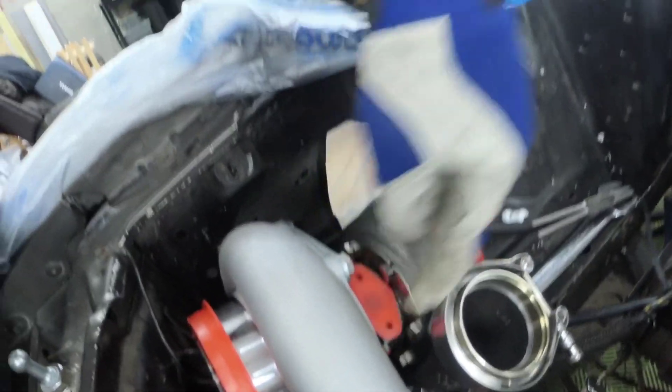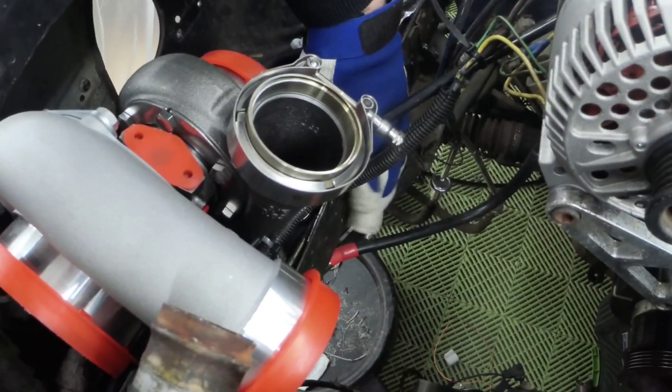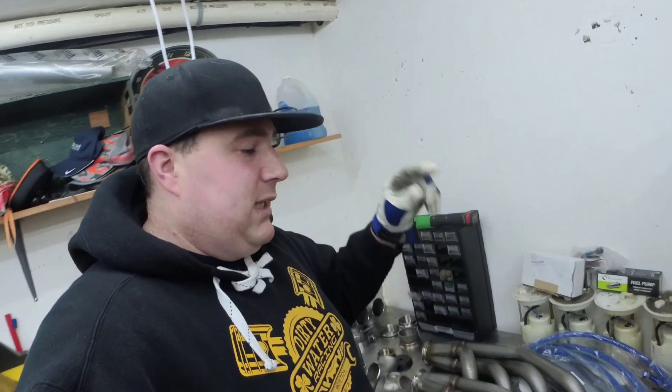We might get some Maven oil turbo mounts — what that is, is it mounts to the oil drain of the turbo and has two sides where you can weld a one-inch steel tube to mount them somewhere. We might mount them off to the side on the frame rail, or figure out a way with the tube front end. So it'll be on the drain of the turbo, then go down to the frame rail, with a one-inch DOM tube coming up in a bend hitting that Maven mount — we'll weld it to the Maven mount and that will be a fixed mount for the turbo itself.